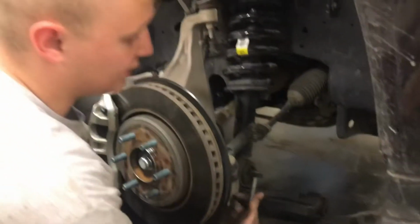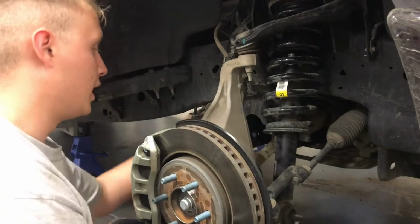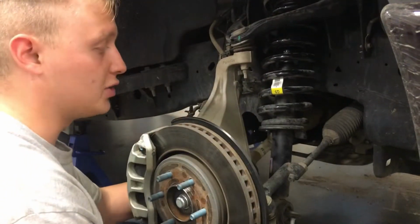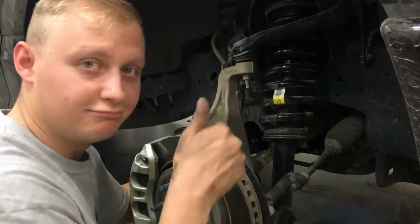Yeah, you'll realign these 2 bottom studs back into the holes in the lower control arm and bring it up. And this end link that was over here, you want to make sure you line that up as well. And throw the jack under the control arm, bring everything back up, and start reassembling.